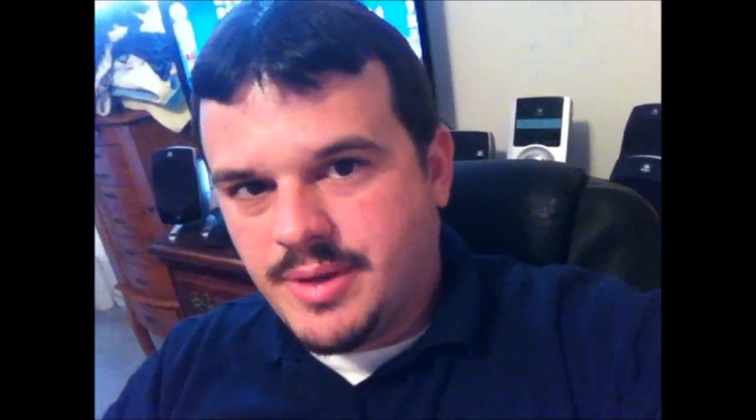Typically, that internal device needs a separate cable for power, whether it be a 4-pin Molex crossover to SATA power, or just SATA power directly from your power supply, depending on what kind of power supply PC you have. Now, external SATA is keyed differently. I'm going to flash a picture of the difference between E-SATA cables and E-SATA-P, which are E-SATA power cables. Both of those are keyed differently.